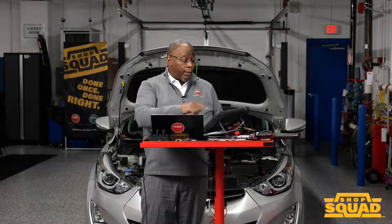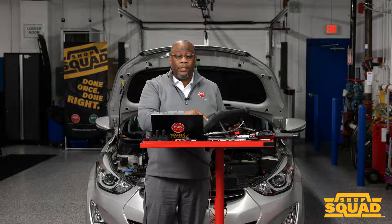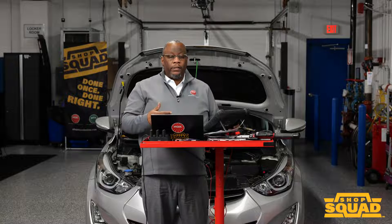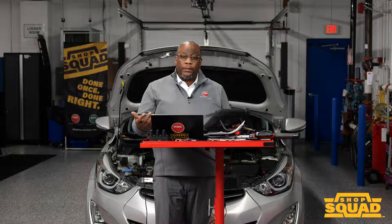It would say yes or no. I'm going to hit record and go to a road test. I want to see whether that yes or no cam and crank synchronization status changes from yes to no within my road test. And right through that diagnostic process, we are validating that we lost synchronization between cam and crank at some point, which gives us a really good direction to continue our testing.